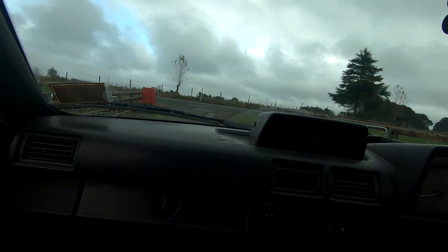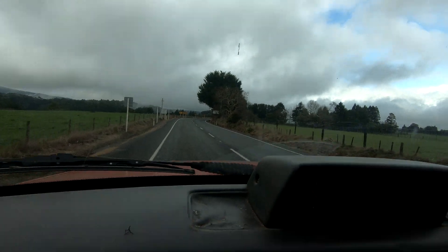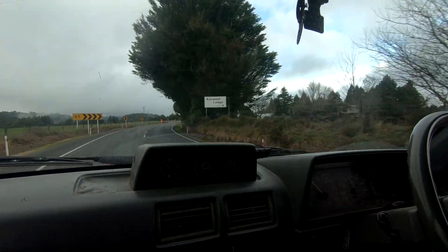Are we good to go up the road? So far so good. This vehicle was intermittently playing up so we won't know 100% whether we've got it. We often get asked where do you start — we started by opening the bonnet and using our eyes: broken igniter plugs, air leak on the front of the intake manifold, igniters flopping around not earthing properly, and when Jason did the bolt, the bit it was bolted to fell out. The release bearing makes noise when you put your foot on and off the clutch.